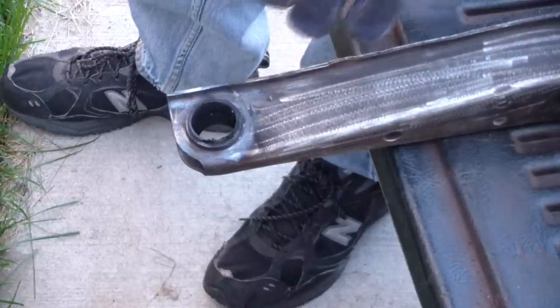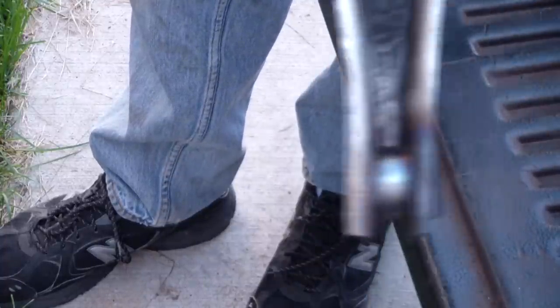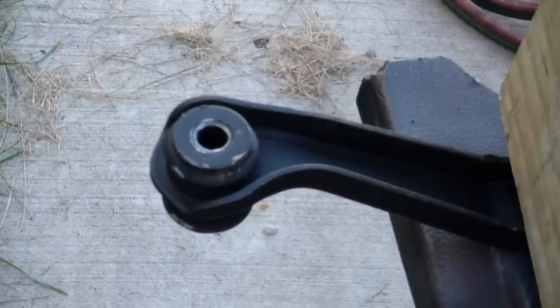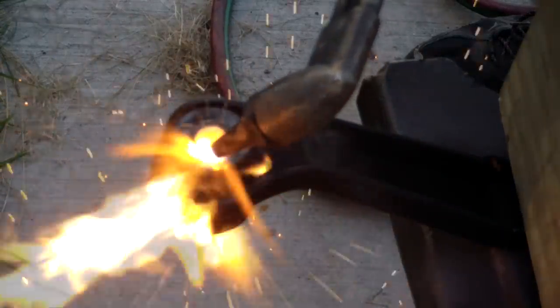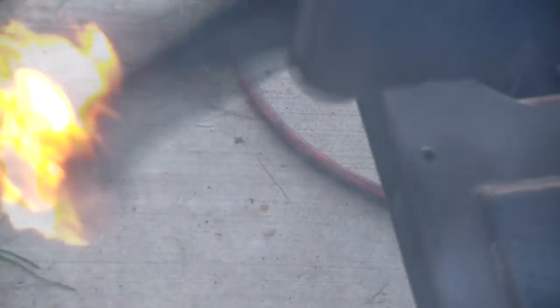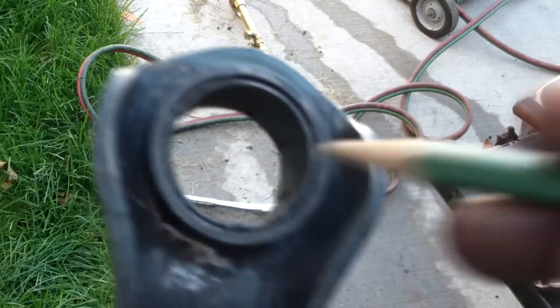You have to be careful when doing stuff like this — I've seen parts go flying under pressure. I'll clean this up and get some rust treatment on this piece and I'll do the same for the upper control arms. Here's an upper — trying to break this encapsulating washer system with a hammer and a punch and it didn't want to go. So I'm going to hit it with the torch a little bit to see if I can separate it and get that bushing out of there. If I had a kit with new bushing shells I could make a slit with a hacksaw and then the bushing shell would easily pull out.